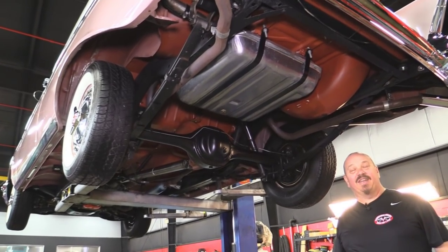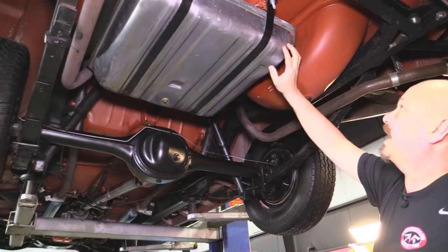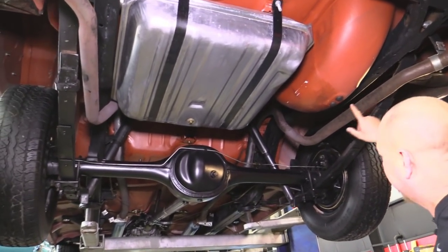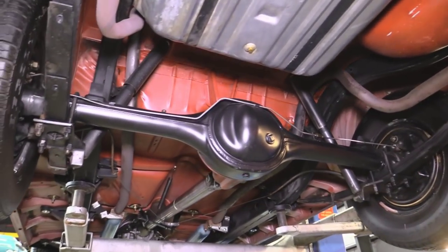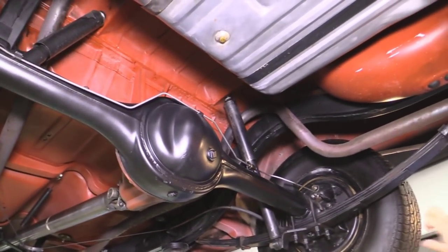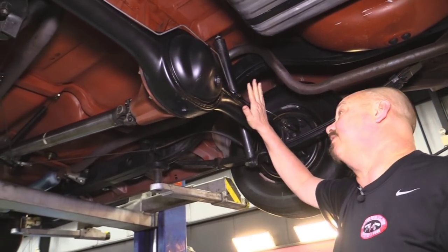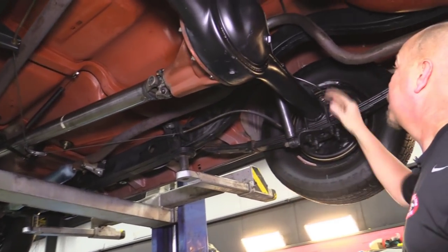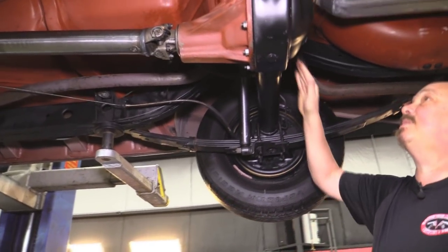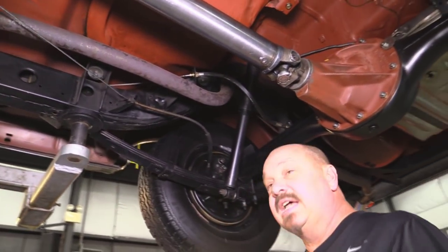We're underneath the Dusk Rose 57 now. As you can see, she was rotisserie restored — she's got her primer underneath, it's beautiful. Brand new tank. The exhaust system's in great shape, but this was probably done back when they did the restoration. It's got some surface rust on it, but as solid as can be. The frame is beautiful, nicely painted. Springs are definitely new. We've got a 1957 rear end in this baby — the date code says it's a 57 also. The center section's got a 308 in it and she is posi. Shocks look like they're also new. Brake lines look like they've been all cleaned up, some of them actually look new. All the body mounts are new. Looks like the parking brake cable's hooked up.